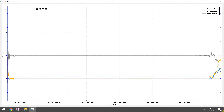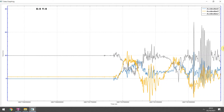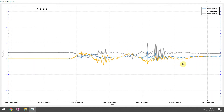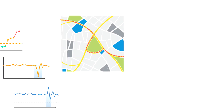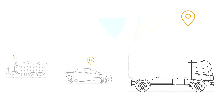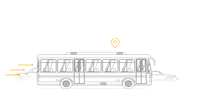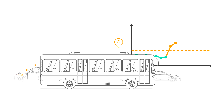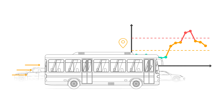You can also stream the CAN mod sensor data in real-time to your PC for visualization in, for example, Savvy CAN. Next, let's take a look at the various sensor outputs provided by the CAN mod GPS. First, the module outputs the GNSS position in the form of longitude and latitude coordinates. Second, the module outputs speed, which can be used in, for example, vehicle telematics to identify speeding, idle time, asset utilization rates, and more.